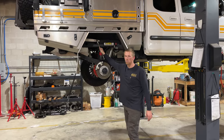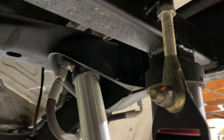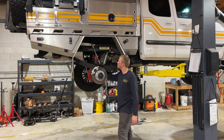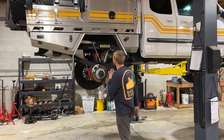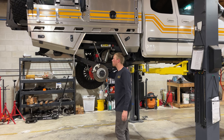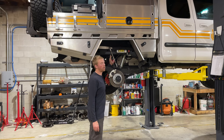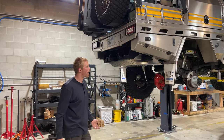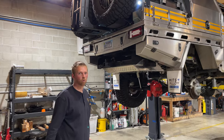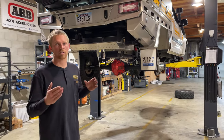There is an Anti-Rock rear sway bar. Rear shocks are also a pair of 2.5-inch ADS shocks with remote reservoirs and adjusters. Behind the leaf springs there's a set of SPC 3-inch travel bump stops — slightly longer travel than the front because packaging back here is easier. Behind that are rear limit straps. The bump stops and limit straps are mounted to an additional cross member in the rear that runs above the axle. There's also a set of Archive Garage shackle hangers and shackles — reinforced units that help eliminate jitters in the rear as the frame rails flex.